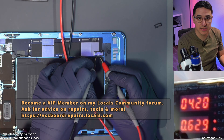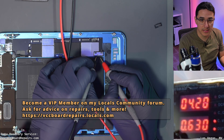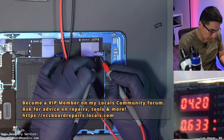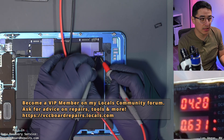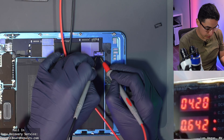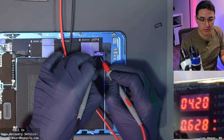We have 0.6 amps being injected into the battery. That is basically going to charge up the battery to some degree — this is essentially how a battery charger works, with current flowing into it. Let's give it a few seconds to charge up and then we'll measure the voltage again.